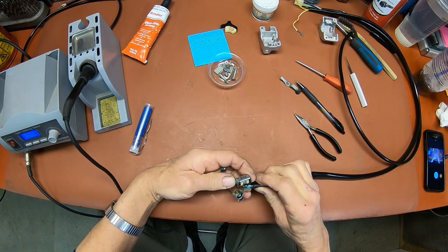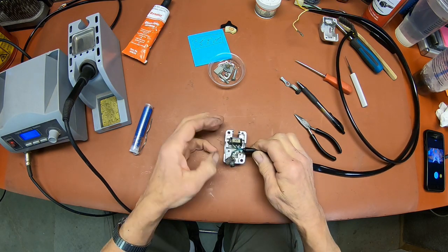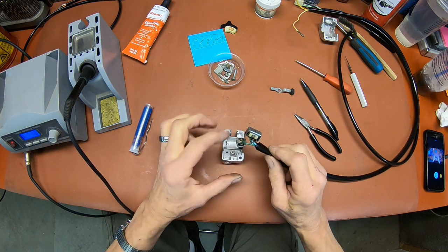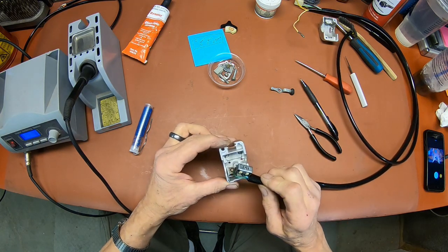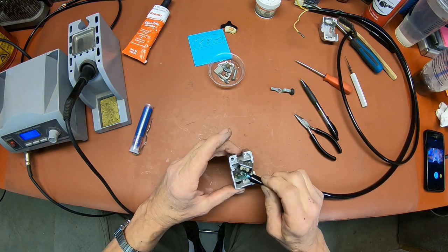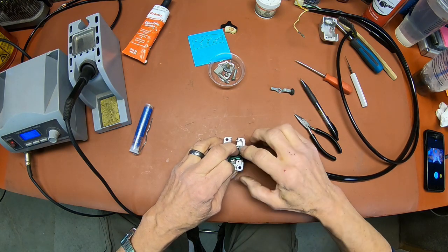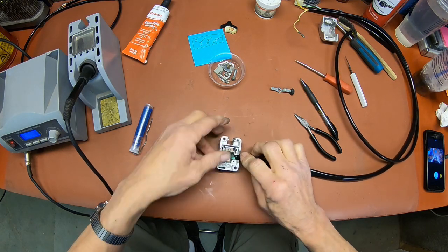But that should be all right, because once it gets in there, then it's connected up the way it should be. Okay, so we've got this switch. You can see where the handle goes is oriented toward the top, and the horn switch, just get it in there. Got to turn it like that. Get it in the hole, and then this one here just pops right down in there, just like that. And then all these wires go down through that slot.